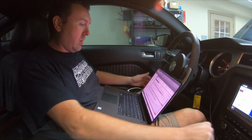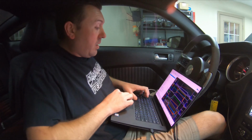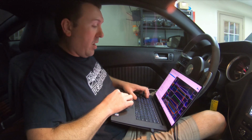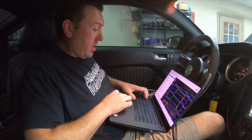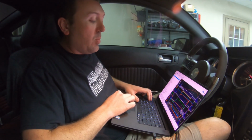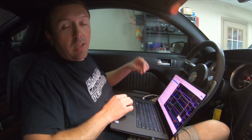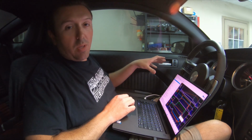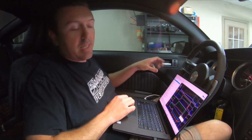Save that run. Ignition timing is just a smidge higher, about 1/10 of a degree. And for anyone that knows tuning and mass air transfer functions, this cold air is a little bit different than the JLT, so our calculated load is actually coming in lower than it was before, causing us to drop to a totally different cell where we don't have timing locked in.